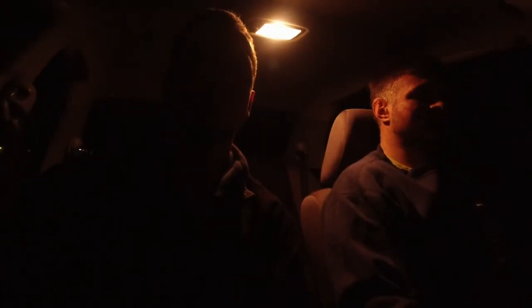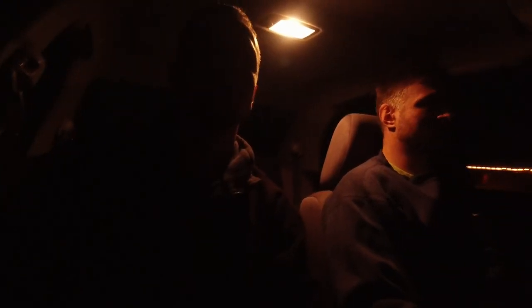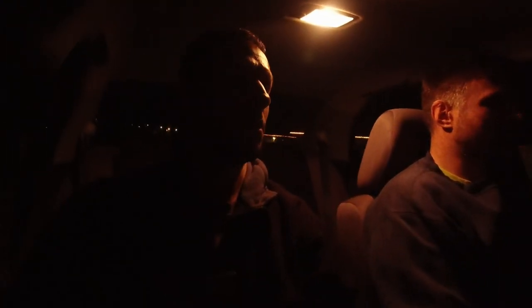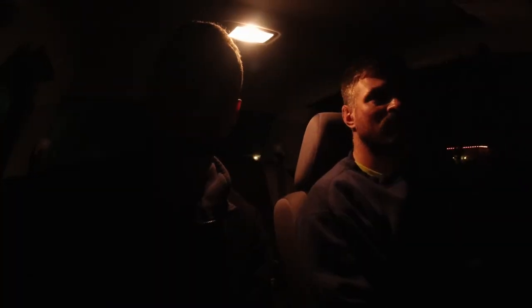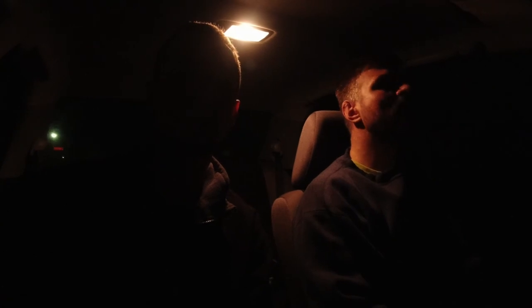Let's turn these lights on — pretty good actually. So we do have lights and we can see what's ahead of us. No knocking. We're doing about 20, 25. What's that noise? Sounds like a gearbox — could be anything. Creaking noises from the front. We probably should put it all back together and then test drive it — not halfway — and listen for noises. There's stuff missing like the subframe. Oh, it's the fender liner — it's rubbing against the wheel.